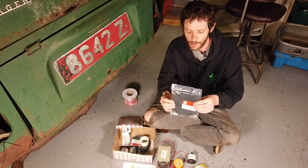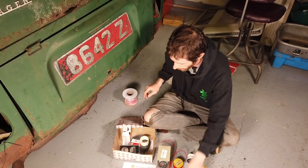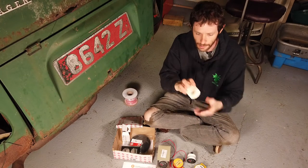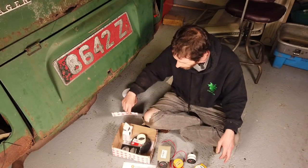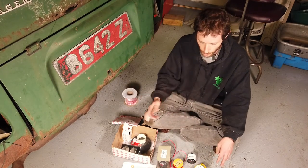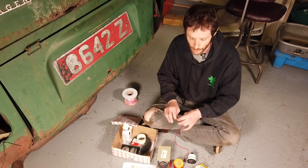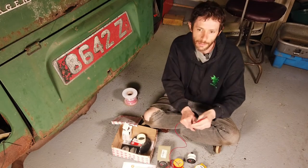I've got some wire wrapping here to make up a kind of a loom, just to protect the wires from rubbing against metal parts and heat. I've also got a little plate for the dashboard so the two gauges will go in there and hang underneath the dashboard, secured with plastic circular pieces at the back. I've got a little wiring diagram I drew up, and the first thing we'll do is make up the mini wiring loom for this setup outside the van, then install it. We'll put the terminals on once we decide the correct placement for everything inside the van.